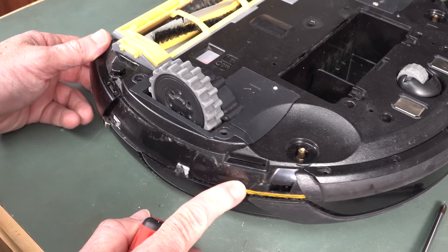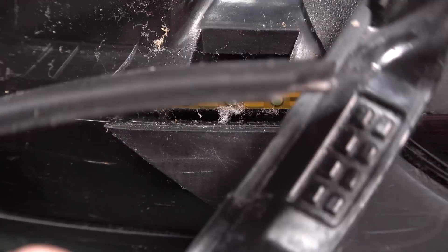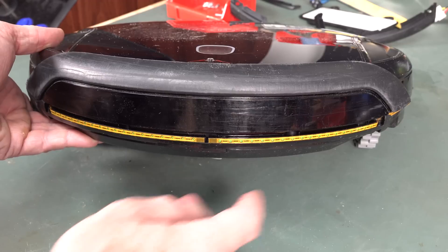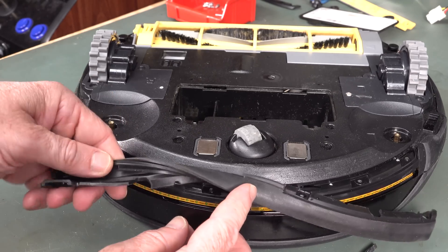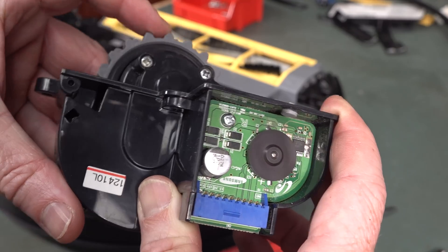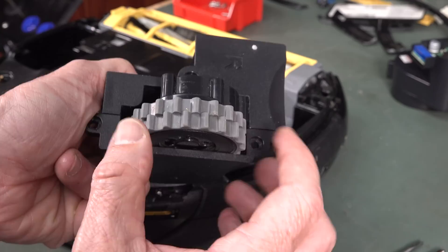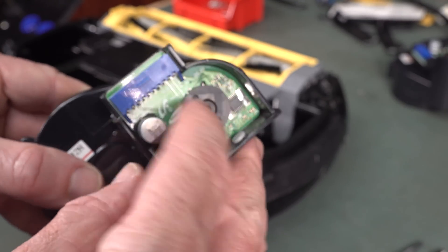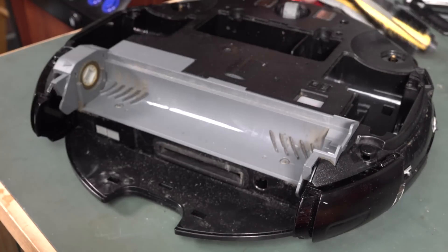Well, it deserved it - that had a flat flex in it. What's really interesting is what was under there. Neither of those is a transparent window. The front rubber baby buggy bumper just comes off. There's the human detector strip right around there - they're obviously not visual because you're not going to penetrate the rubber. I managed to lever out one of the wheels - that's your motor! Check that out, isn't that groovy? I'm going to keep that mechanism. It's got a reduction gear mechanism in there, and that's obviously an encoder wheel - I think there are two magnets either side and then hall sensors either side.